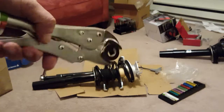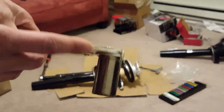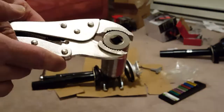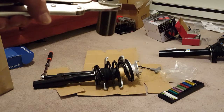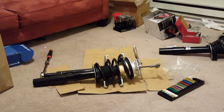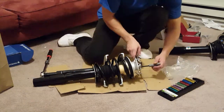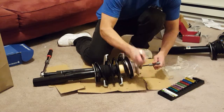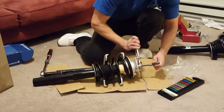The bolt is a 22 millimeter. I did not want to pay $61 for a specialty tool, so I'm using a seven-eighths attached to a ratcheting wrench with lock pliers, and I'm going to use the T-Allen to tighten it up. So you just twist, lift, keep the Allen in place, twist, twist — just keep doing that until it bottoms out. Everything is tightened up.